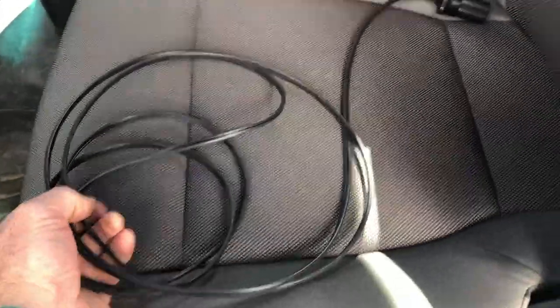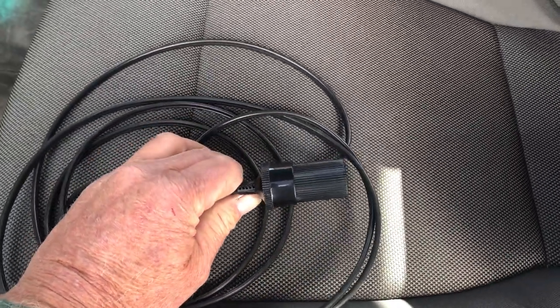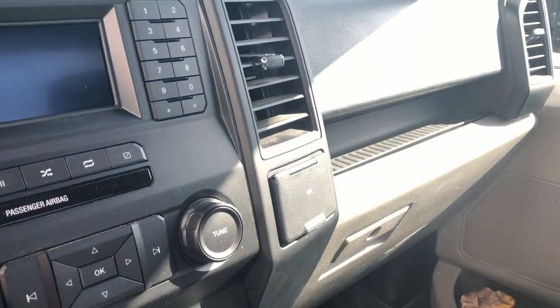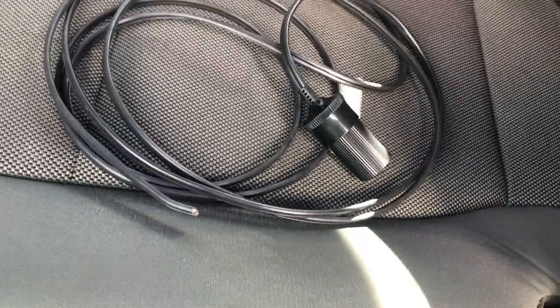I'm going to pull the wire for the 12-volt direct system in through the same spot in the boot that I pulled the breakaway cable. That boot just has a little razor slice in it that we made. I've already got the pull wire through, so it's going to be pretty simple to pull that up through. This is the 12-volt direct power supply - once installed the brake will plug right into this and always have power from the pickup battery. The 12-volt auxiliary plug and cigarette lighter both went to sleep after an hour and a half. I've got my wire through the same hole in the boot - I'll hook this wire onto it and pull it back up through and take it over to the battery.